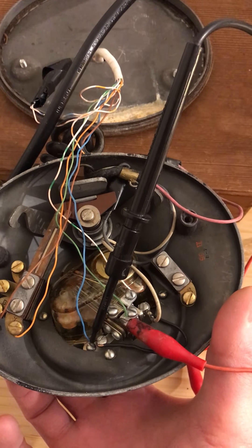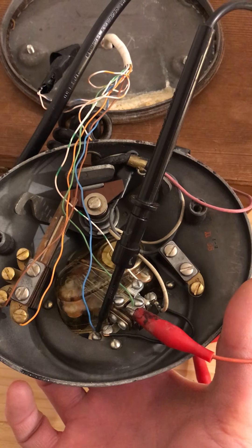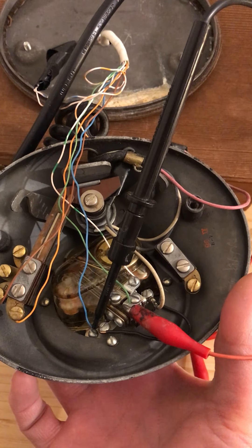Normally you let go and it returns. When I let go, it's going to disconnect for each number — one, two, three, four. Every time it disconnects it's passing through a number, generating pulses. Dialing four would generate four pulses. Dialing two generates two pulses.